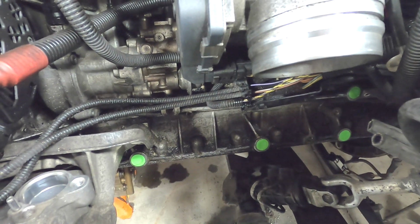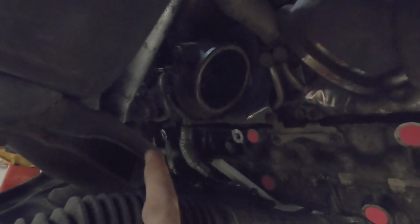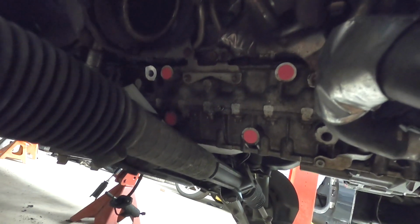The passenger side is a little bit more difficult and a whole other story. So let's talk about that. Okay, now the passenger side is going to be a little bit more difficult. You can see that the E30 mount is right here. Okay, and the points that I've identified to make the bracket are the 4 ones that are in pink. I put pink stickers over them to identify that those are the ones I'd like to make the bracket on.